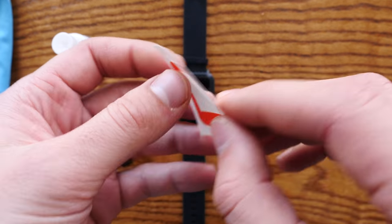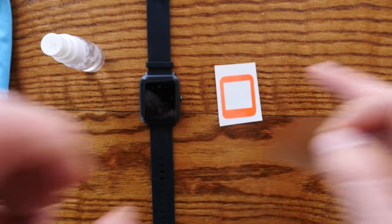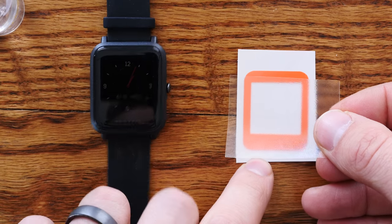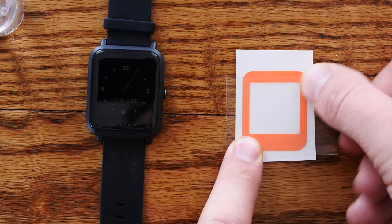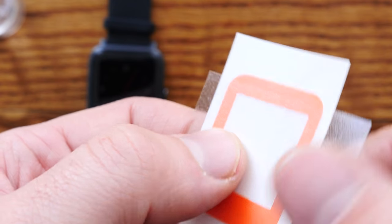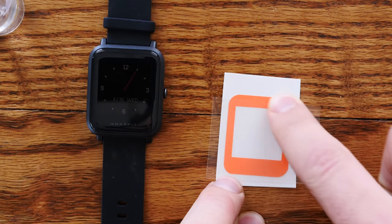So this is the actual skin. There's a transfer film on the back that you peel off. Now what you're going to do is turn the transfer film sideways, exposing the top edge of the skin. You're going to lay it sideways like this, but the top edge is exposed. The point of that is when you put it down on the glass, it will grip and you won't peel it off. Once that's done, rub your finger on it and make sure the transfer film sticks to it.